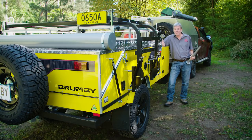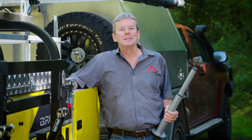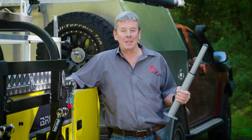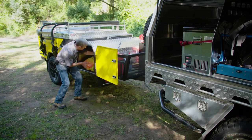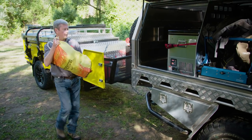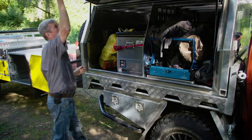If this is within 10 to 15 percent of the ATM of the camper and within the vehicle's capabilities, you're good to go. Once you know your camper's ideal tow ball weight, you can get hold of a tow ball weight scale, which will allow you to get it right every time when your camper's fully loaded. If not, try moving some gear around in the camper — especially anything sitting right up front on the draw bar — to get on the mark.